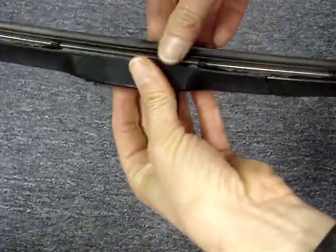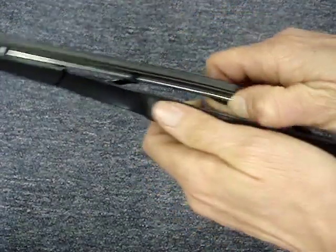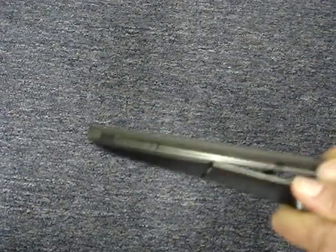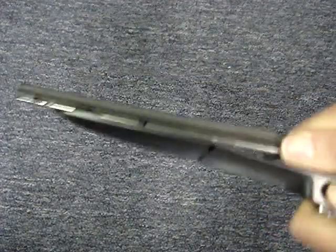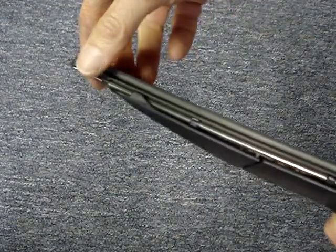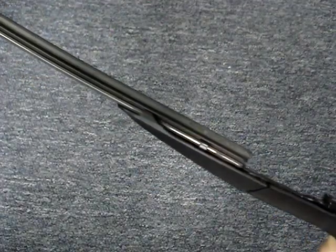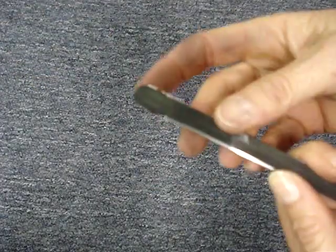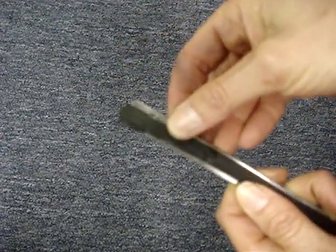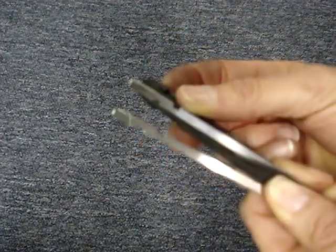To remove this type, grab the refill a good distance from the claw, then push forward until it pops out of the last claw. If the refill has metal rails, pop them out. If they have notches, take note of their positioning.